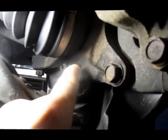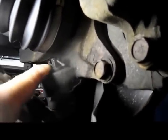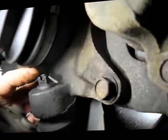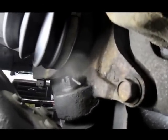The first thing we're going to do is remove this cotter pin right here, and then obviously take this nut off. Now the right way to take the nut off is to pull the axle back so you can get on here with the box end of a wrench, but there's not enough room inside here and not enough clearance to get a wrench in through there.